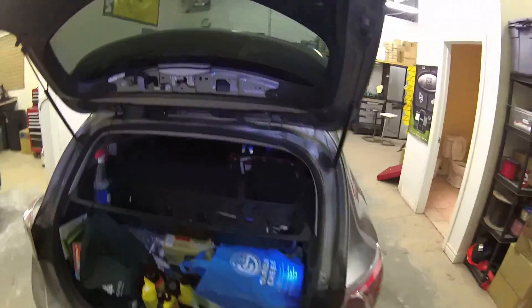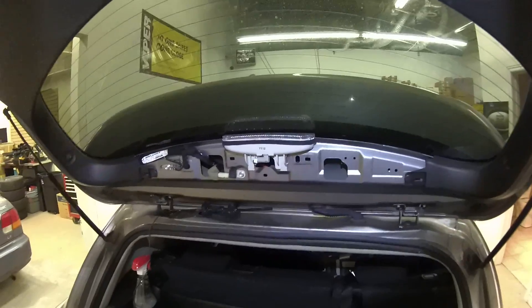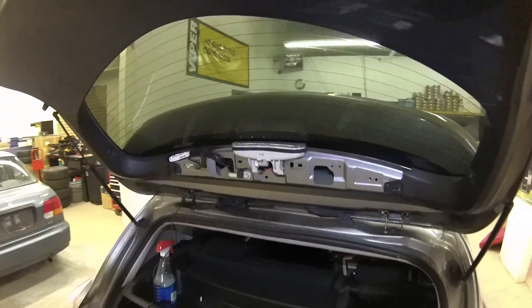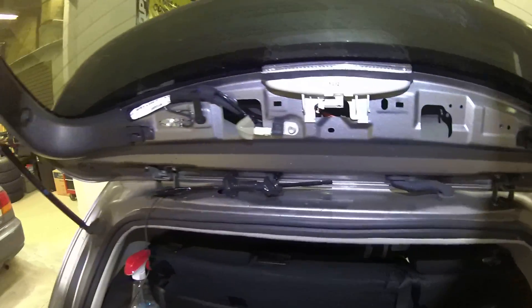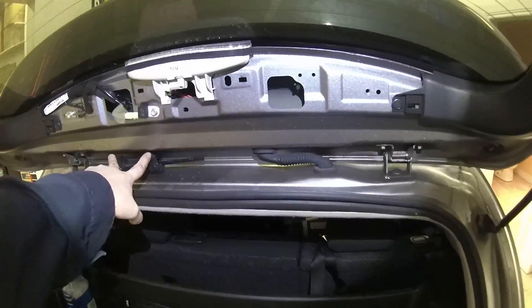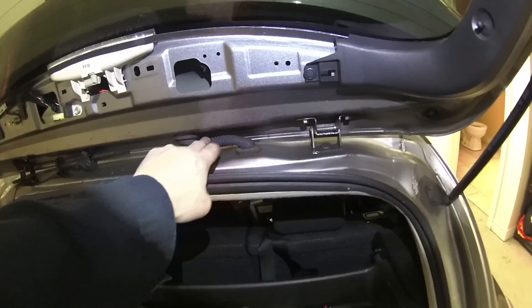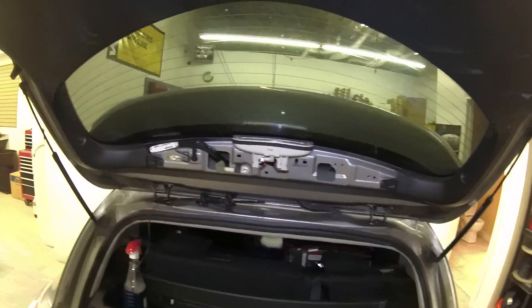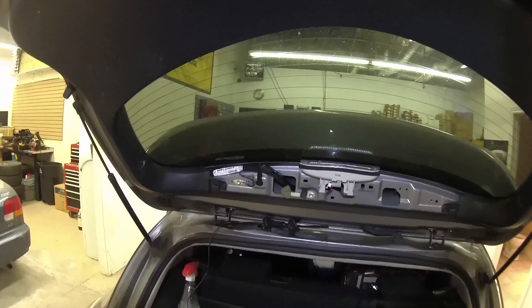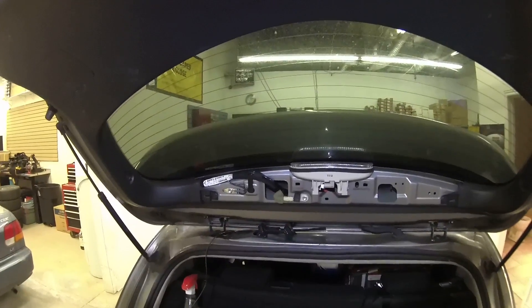What I'm going to show you today applies to pretty much almost any vehicle that you'd be installing a two-channel dash camera on and wanting to mount the camera on the actual hatch. When I say properly run, I mean you want to run cables in a hatchback vehicle through the factory run locations, and on this particular vehicle there are two: the wire channel run, and a water run for the rear windshield wiper sprayer. I'm going to go to the actual wire run on the driver's side because it's easier to access and there's no chance of me piercing a fluid hose.